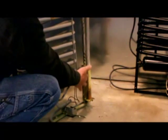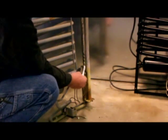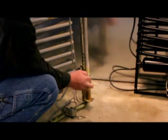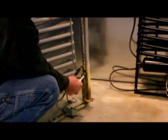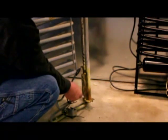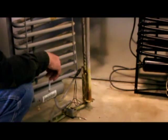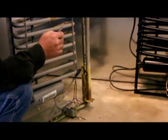Here is the boiler area in the cooling unit. You can see this is the boiler. Here is the 110-volt heat element — it slides into a heat element sleeve that's actually welded to the boiler. Notice this yellow here — some of you will recognize that. This unit has a leak, and we're going to fix that. We'll tell you all about leakers in another video.